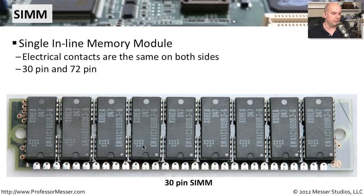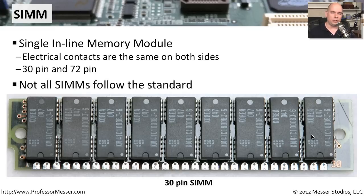There were different kinds of SIMMs: a 30-pin version and a 72-pin version. This is an older style of memory you no longer see. If you encounter a very old system, it may have SIMM modules, but you won't be able to buy new ones — only used ones. Generally, those computers are so old that memory upgrades aren't a concern. Importantly, during this era there were no standards across the industry. Some SIMM modules worked on some motherboards and not others. Even though they looked identical, they weren't following a strict standard.